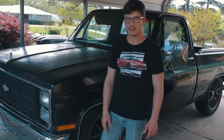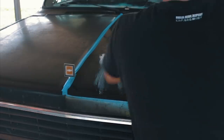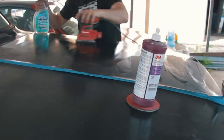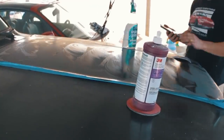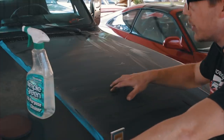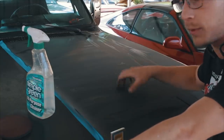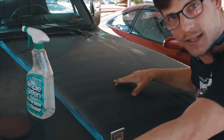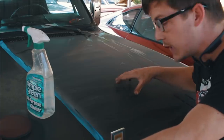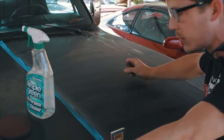So it is time to get to work on this paint. I hope that this is fun. Wish me luck. So it may look like I made the hood worse — I'm only doing this side right now — but I want to show you guys what you can do with old, worn-out paint. I started with a buffer and that didn't really work; it just wasn't cleaning as fast as I wanted. So I went back to some sandpaper: first I used 2,000 grit and then 3,000 grit, and we sanded this paint. It looks like this is a single-stage paint — we'll know in just a minute.